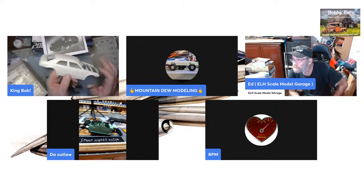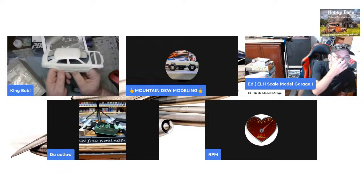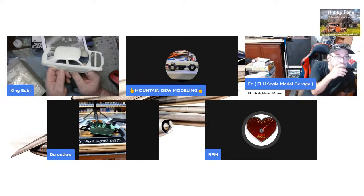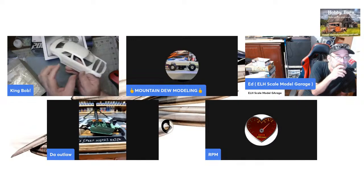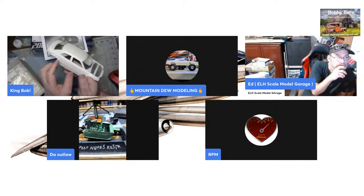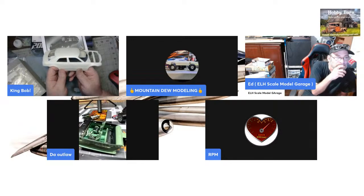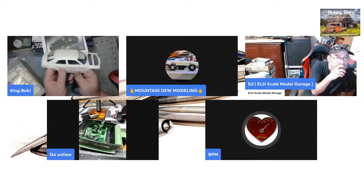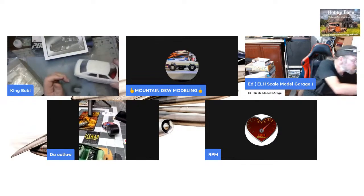Yeah, because the only hard part would be doing the door sections. Not necessarily, if you cut it right center of that B pillar. Yeah, but the filler panel to go between it. Well, that's what I mean. If you have my kit, then you just take the two doors from wheel well to wheel well, stretch it however long you want. You got the roof piece that has the same arch. The rest of it's garbage, and you fill it in. Yeah, with the second body, it would be a lot easier.